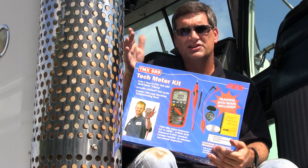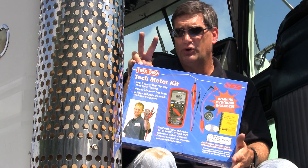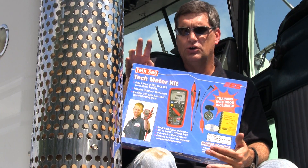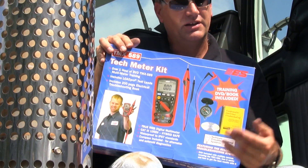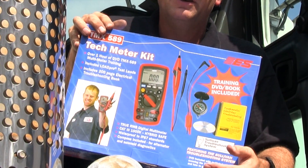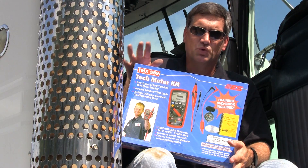If you have full system voltage, you can't have an open or short — those are two of the only three faults. So if you see system voltage, you rule out opens and shorts. You just push the button on the LoadPro and if the voltage doesn't drop, you don't have a wire problem. It's really that easy. You go to the load, unplug it, turn it on, read voltage, push the button.